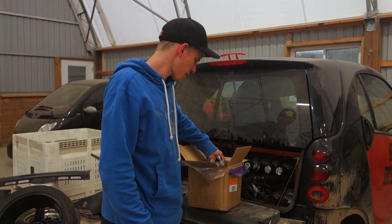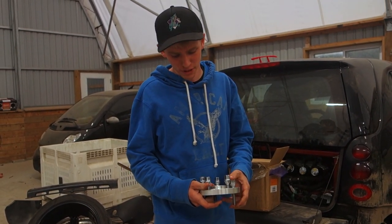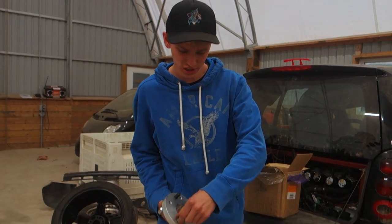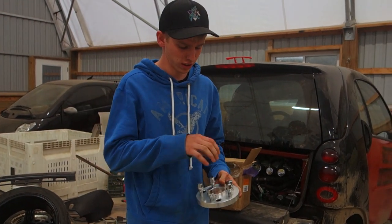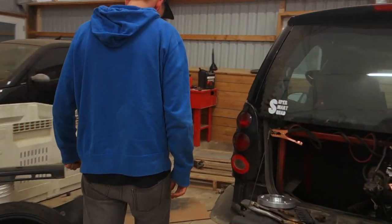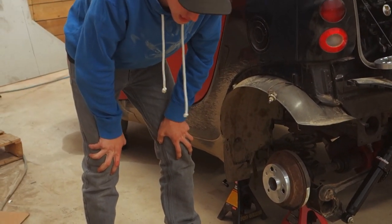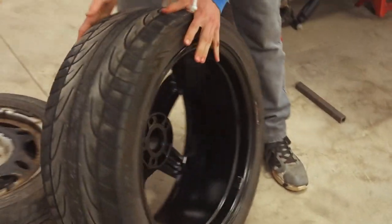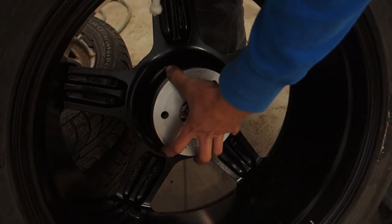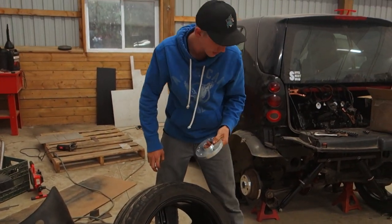I bought some adapters for this car to go from a three-bolt to a five-bolt, five by 112. These spacer adapters actually cost more than the whole car originally cost, but they're all hub-centric, and the new wheel is hub-centric as well. We mocked one up just to show you what they look like on the side of the car — awesome quality on these things. The only issue is they don't quite seat into these AMG wheels, so we're going to have to sand a little bit of powder coat off the ridge here to make them sit flat. You can see it goes almost all the way on but there's just a little bit of paint in the way.